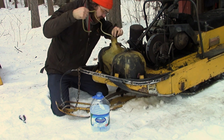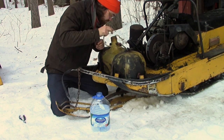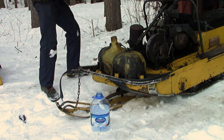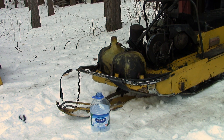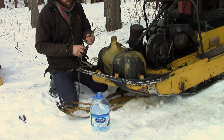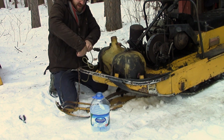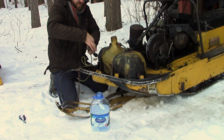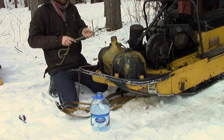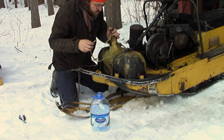Down into the bottom. There's barely any gas in it, so we'll see. You know what? We'll tape a stick on here. All right, we're gonna use this little trick. To get the bottom of the tank fully siphoned, you need something rigid to hold it down at the bottom. So I'm just gonna use a screwdriver, tape it on, and that way I can hold my tube right at the bottom, just like that. There we go. It's gonna work, maybe.